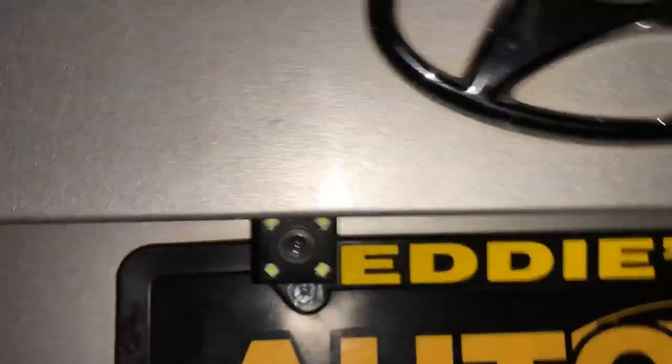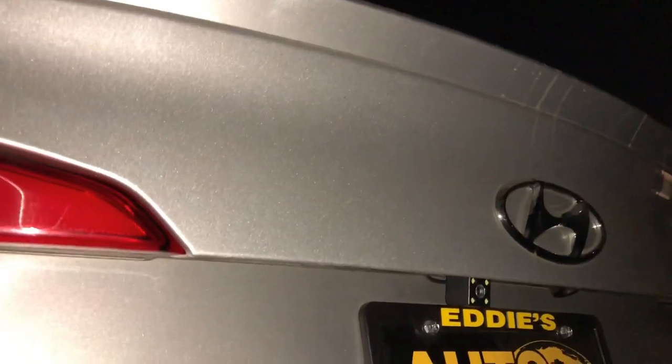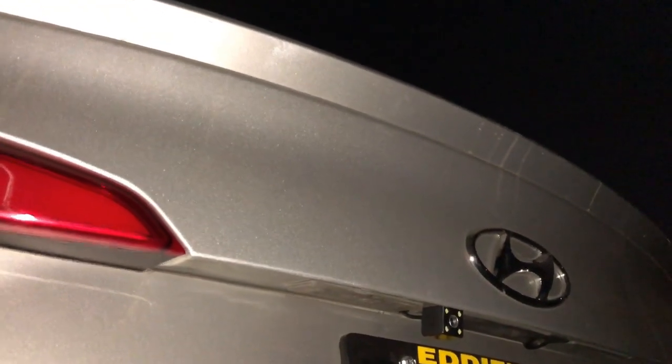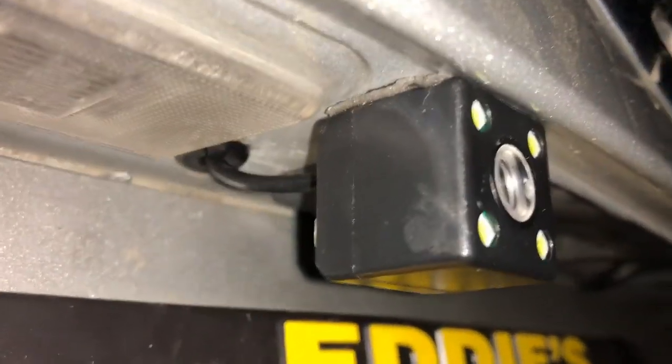Here's where the camera is located - right there. There's a grommet I used after I drilled the hole. It was kind of hard because this area angles downward, so it slopes and it's hard to get the drill bit in there to drill a straight hole. I used a center punch to keep everything as straight as possible. Once I drilled it, I put the grommet in and ran the camera with some double-sided sticky tape right there.